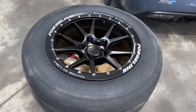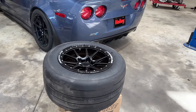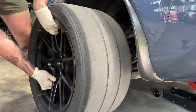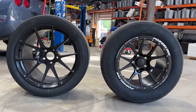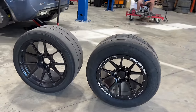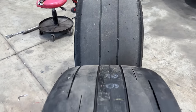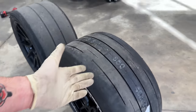First set of beadlocks down, and I have to say I greatly prefer this to using a tire machine. Now comes the important part — do they make the car look faster? Side by side, they definitely look tougher. They are the same wheel, just a 17-inch version with a beadlock thrown on it. One thing I thought I was going to be giving up is a bunch of section width — this is a 305, that one's a 345. We're definitely going to be losing something, but I don't think it's going to be as horrendous as those numbers suggest.